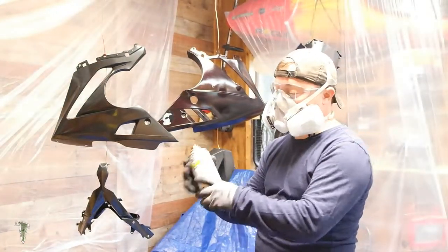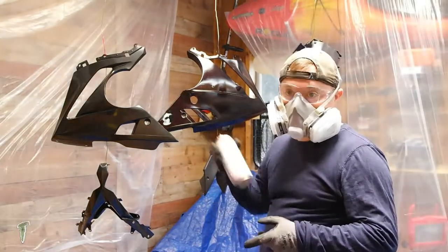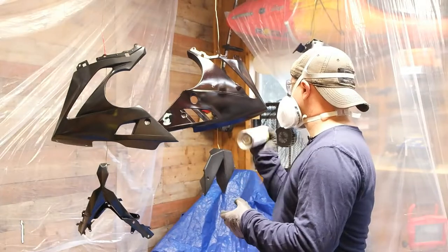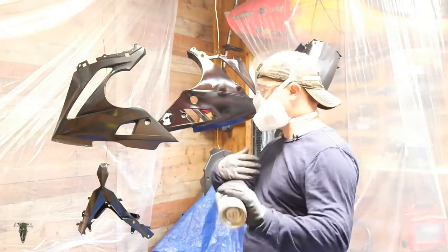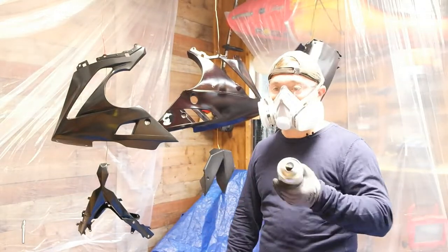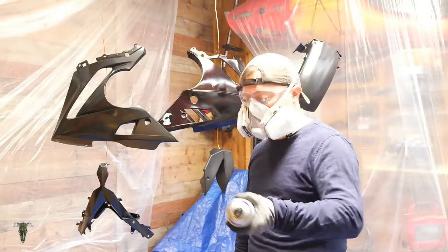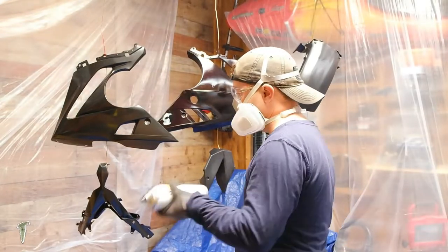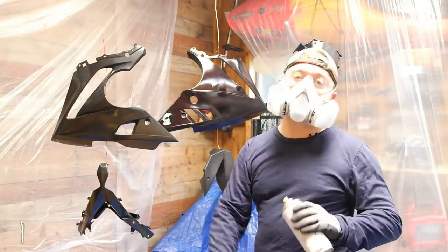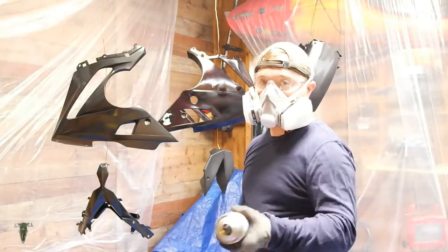You do not want this stuff on your skin. You damn sure don't want to breathe it. It will set up and harden in your lungs. It'll harden in your eyeballs. It doesn't matter. And it can kill you. So after I spray a coat, I'm going outside. I'll wait 10 to 15 minutes, I'll come back in and shoot another coat.